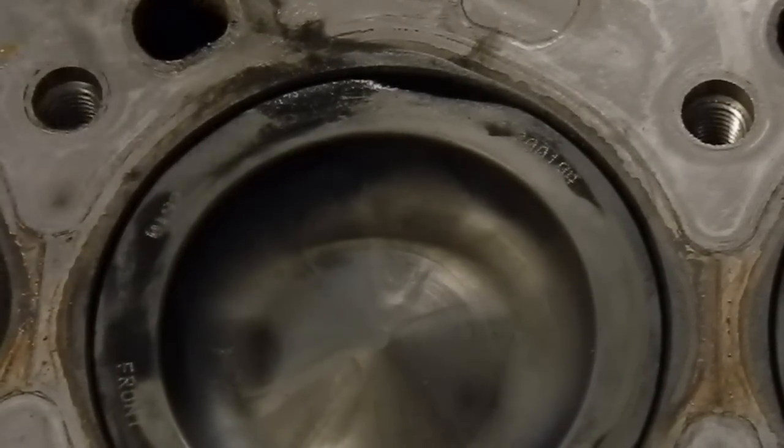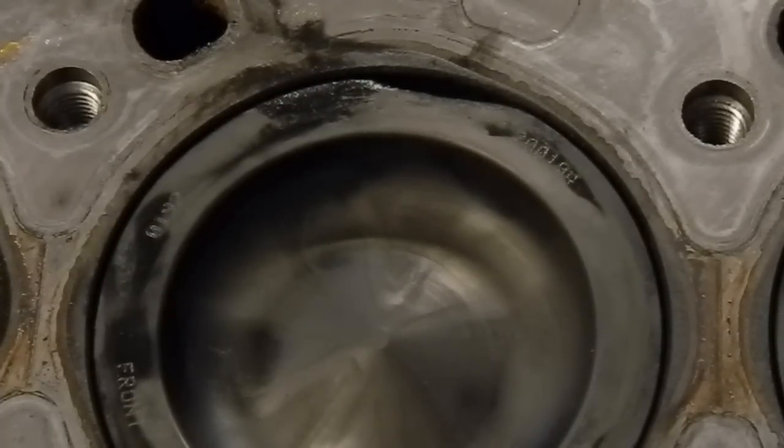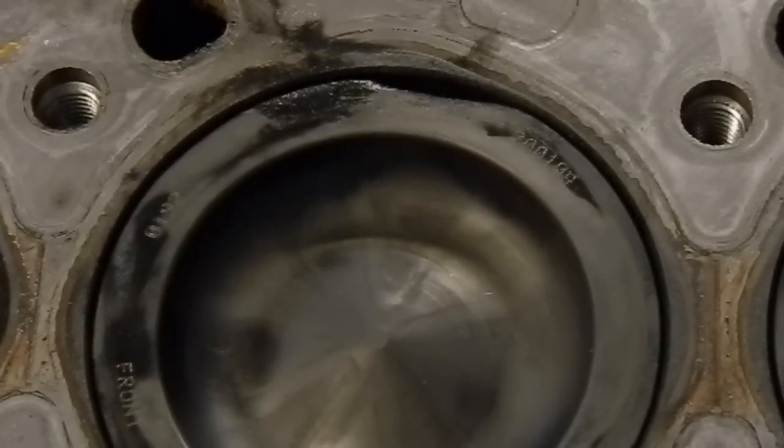And the pistons that we're going to put back into this Cummins are ceramic coated by Polydyne, and they have the Polydyne DL on the skirts of the pistons. We're going to be taking some extra precautions on this motor. Like I said, the ceramic coated pistons, the Polydyne DL on the skirts, and then we even had the bearings coated for this Cummins, the rods and the mains and all that.